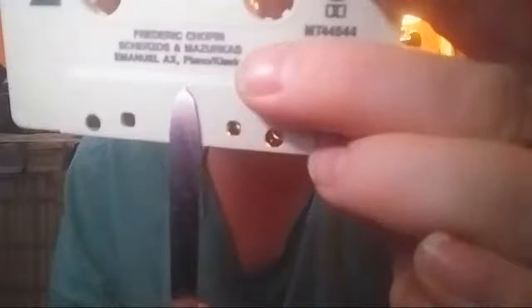Another thing you can do is adjust your head, because your head goes up into the tape. That's why some players will play a binder hydrolysis cassette better than others — if it's a player that pushes the head all the way up into the tape, it won't play. You can use 99% isopropyl alcohol inside the tape, but you have to use a very small amount or the tape ribbon will curl up and warp.